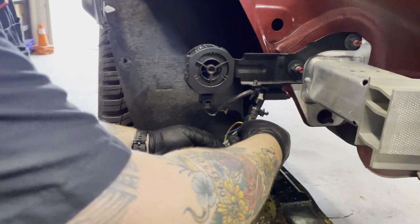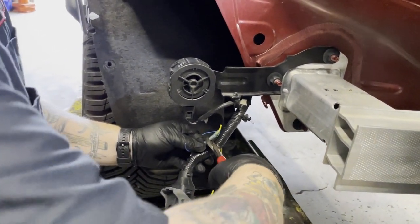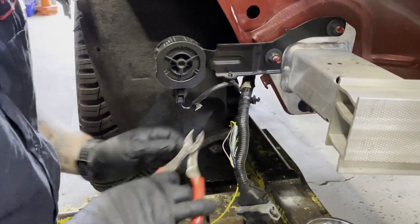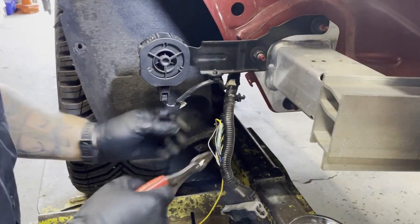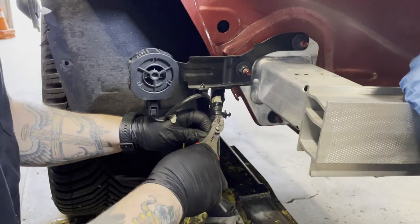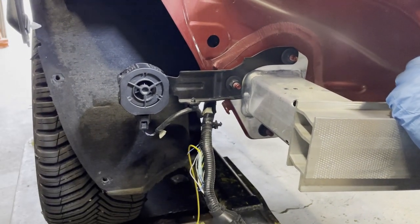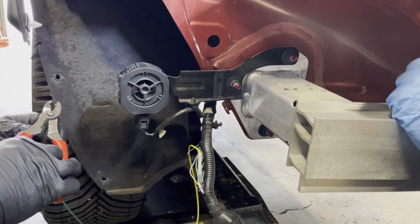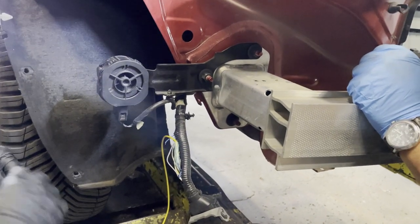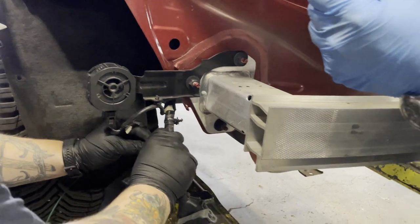Twist the bare end of one of the cut passenger's turn signal wire with the supplied green wire. Insert one end into a splice connector and crimp it. Next, trim the other end of the supplied yellow and green wires. Strip and crimp the added yellow wire to yellow turn signal wire of the tail light converter. Strip and crimp one end of the supplied brown wire to the brown wire of the tail light converter.